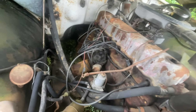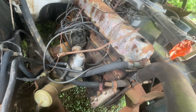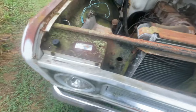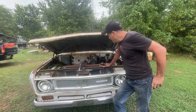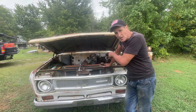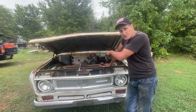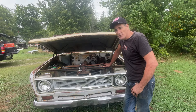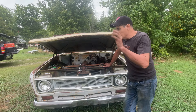Last we left this thing, my compression gauge broke, so I couldn't get a good compression reading. I've got a new one with me. The carburetor is completely shot, so I brought one of those with me. But the first thing I'm going to do is do a compression test. This engine spins real easy, maybe too easy. So I'm thinking the compression is probably quite poor. The other risk is maybe the timing chain jumped, and I'm going to check that — although I'm going to wait a little bit to do that.